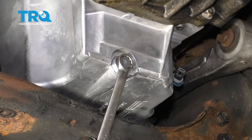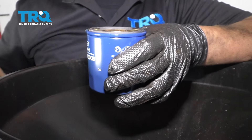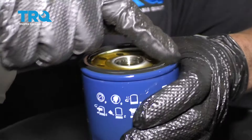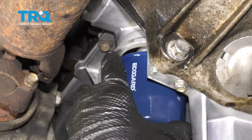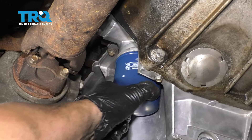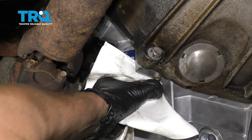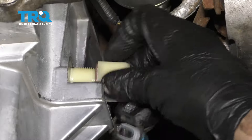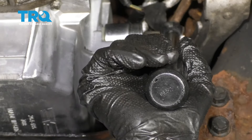Just double-check to make sure the drain plug's tight. Now I'm just gonna prime the filter with engine oil — just make sure you use the correct oil. Try to get it in that center hole, and just make sure you get oil on the ring of the seal. Now we'll install the filter, line that up. And then once it's snug, go about another quarter turn. Take the level sensor and carefully slide it in the hole. You can torque this to 115 inch-pounds — make sure you're on inch-pounds, not foot-pounds. And take the plug, line it up, plug it back in.